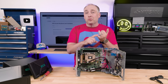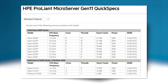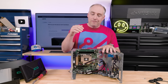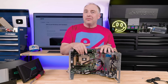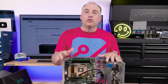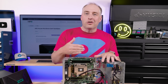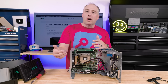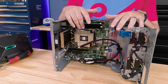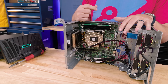This system can take two different types of Xeon processors. At launch we got the Intel Xeon E-2400 series, but now it can also take the new Intel Xeon 6300 series. HPE is now offering higher core count CPUs. I feel this should be an AMD EPYC 4004 or 4005 socket — one of the big markets is Microsoft Windows Server for SMBs, where you only get a 16-core license pack. AMD has that option. The Intel Xeon also requires a PCH, adding extra power and cost that AMD platforms don't need.